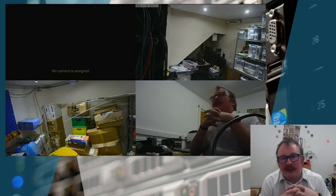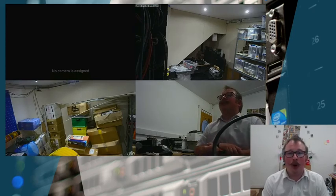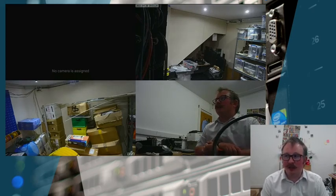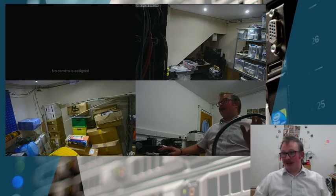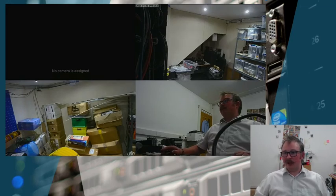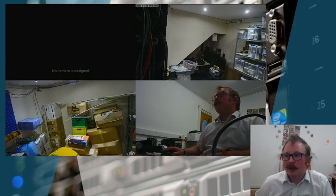So the good news is that I do now have that working. All it took was about half an hour of messing around, trying different cables, moving things around, and I think the problem is that all my stuff here runs through an HDMI switch, and the HDMI switch box is a 4K switching box, and I think something was getting confused because the input and the output weren't lining up properly. So I think the viewport was outputting in 4K but the capture device was only working in HD, in 1080p. So anyway, that now seems to be resolved. You can see now that we have on the screen there, feels like it's the wrong way, but you know, the view.